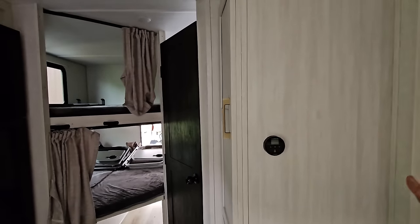Okay, so I figured out what I need to do. I'm not going to do it today because I got to think about the wiring aspect of it, but I need to rewire the thermostat independently of the air conditioner. Basically, I need to take the furnace wires coming out. Thankfully, I have the 12-volt wires right here, which will still allow me to power the thermostat, and that's the reason why they're there.